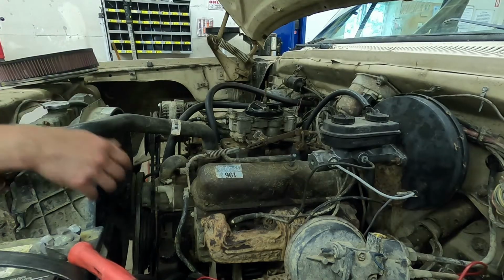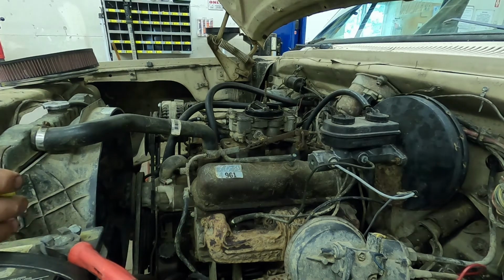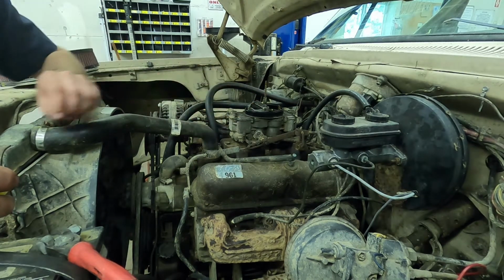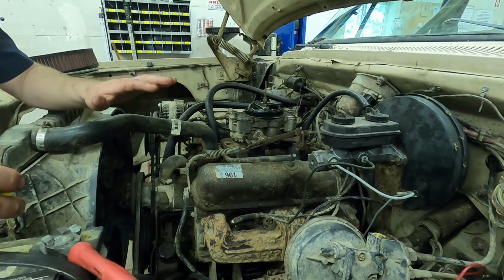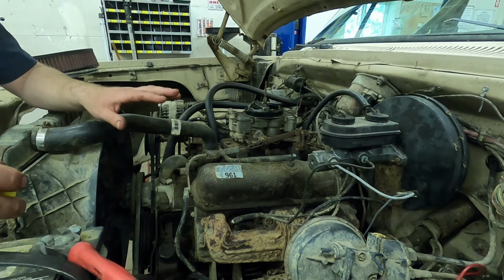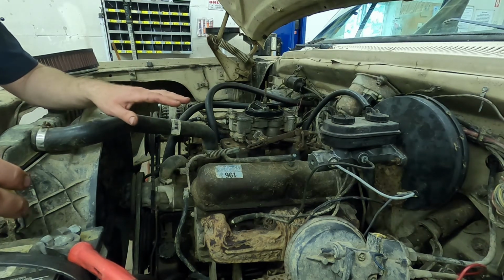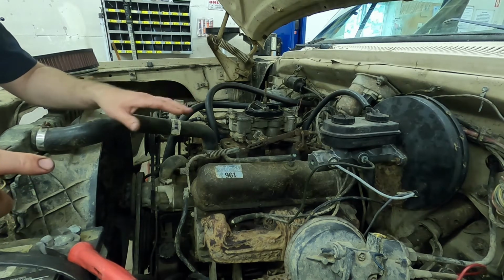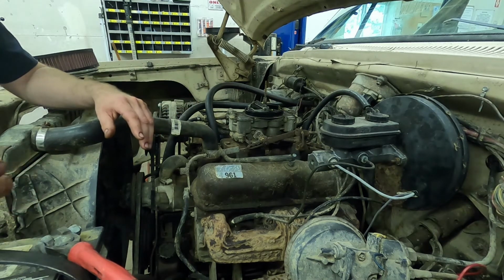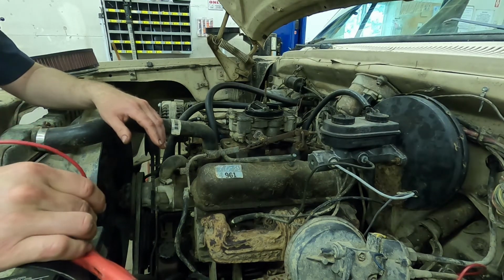Now I have the key turned on. I have a wire out here that I can engage the starter automatically. So the ignition's on. This thing should fire right with the carburetor full. If we verified our ignition system, this engine should theoretically fire right away and run. And that's what we want. We want it to fire up right away, and as soon as it builds oil pressure, we actually want to rev it up a little bit to throw oil up on the camshaft. We'll see what happens. This one might start.